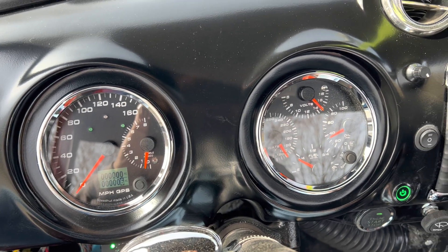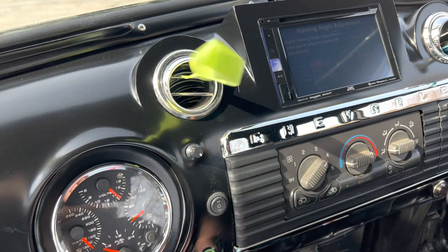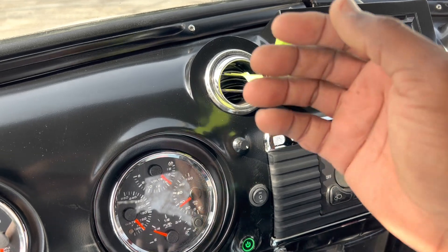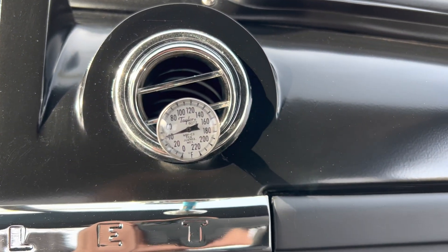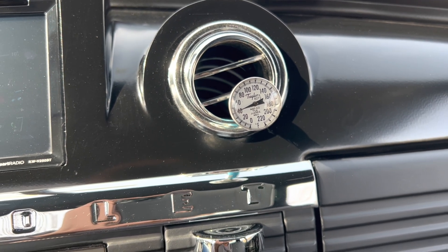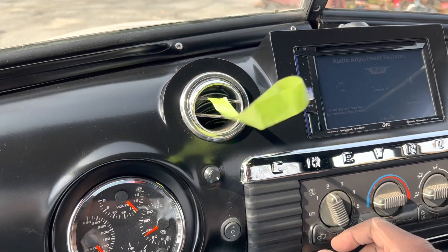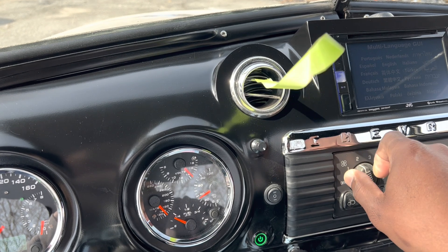This illustrates how hard it's blowing — I have it on speed five. I'll turn it down to four, still blowing pretty hard. Down to three, two — I think two would be okay in this truck. Even at speed one it would really keep it cool. At one, the discharge temp is showing about 41 or 42 degrees. I have it charged — it's not low; I charged it to about 30 ounces. It's pretty cold in here. It's not a cool day either — it's about 65 to 70 degrees outside with all the windows open.